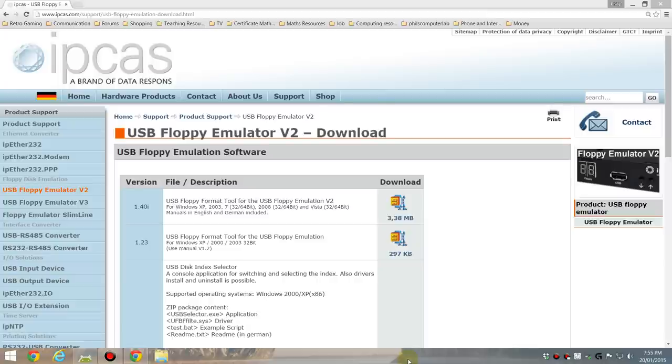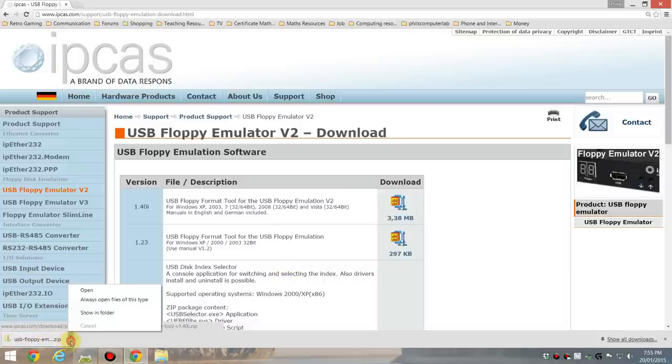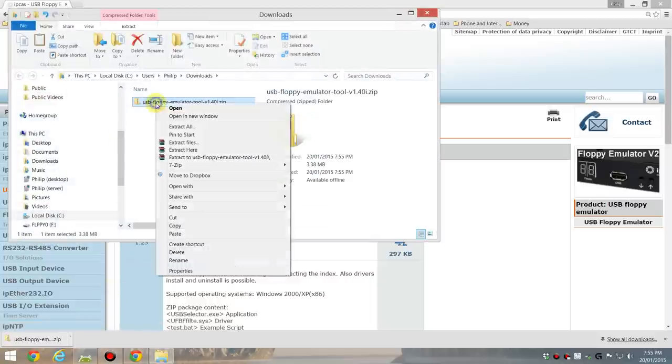So the software I recommend is from the company IPCAS, and you go to this download link. I'll put it in the description and also on my website, and download the version 1.40i. And I'm just going to put that in my download folder. Now, this program will allow us to set up our USB to basically format it and put 100 floppy images on it, but it'll also allow us to write information onto the individual disks, because by default you can only access the first disk. Okay, so let's unpack that zipped file.